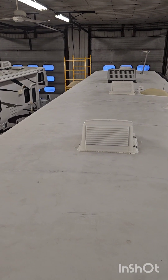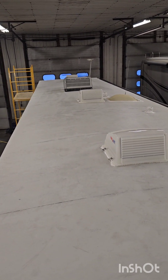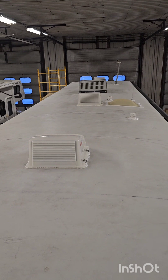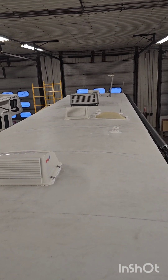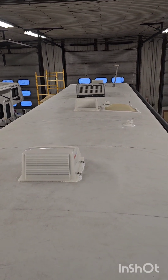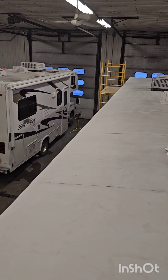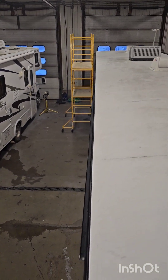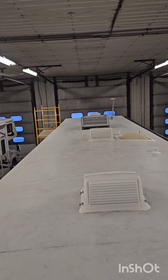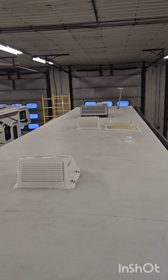The roof maintenance is all done. It's been washed down with rubber roof cleaner, lap sealants have all been taken care of, everything has been spot sealed where needed, and fully resealed where required. Three new vent covers have been put on, including the Max Air covers the customer upgraded to. The side seams on the unit have been done all the way down, slide out maintenance has been completed, a couple of small interior repairs were done, and of course the thermostat issue was addressed. The park model is ready for camping season 2024.